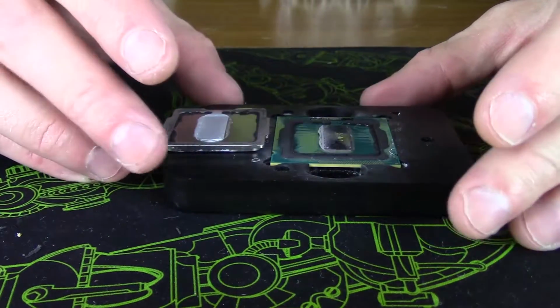Now, Ivy Bridge, whole other story. This is because they use thermal paste between the IHS and the die. So once we got the 3450 delidded, we cleaned up the die and cleaned all the glue off. Now, this is another key point: use your fingernail to clean the glue off. It's going to take some time, but it's not going to damage anything. I definitely wouldn't take a razor blade to it in case you get unsteady and nick that PCB and end up having a dead chip like I have with my 3770K. So keep that in mind.